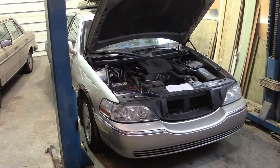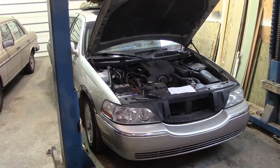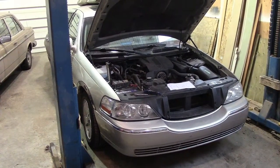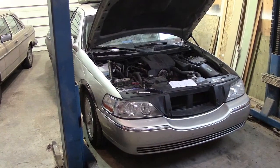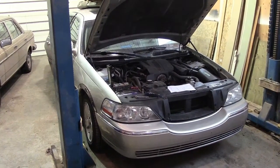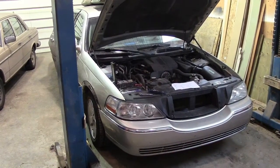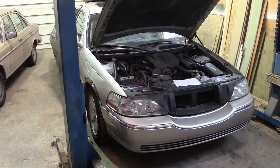The purpose of this video is the rear defrost — Lincoln calls it the heated window glass. The rear defrost wasn't working, and of course we didn't discover that until it got cold. I think I've isolated what the problem is. You won't see this video if it turns out I'm wrong. My suspicion is that it's what Lincoln, or Ford I guess, calls an antenna isolator module. I'm going to show you where that is and walk through the basic troubleshooting I went through.